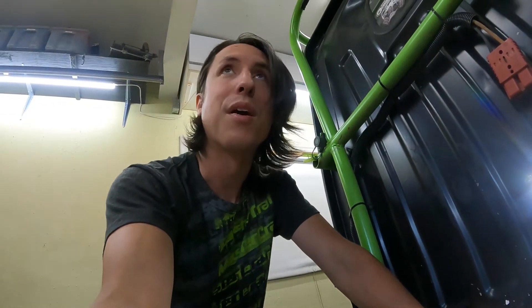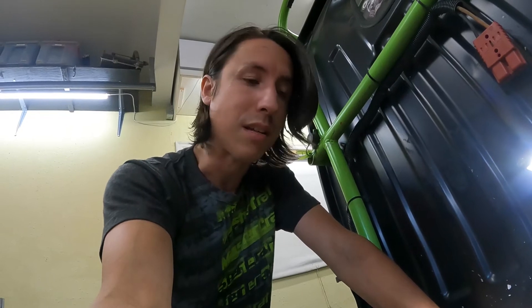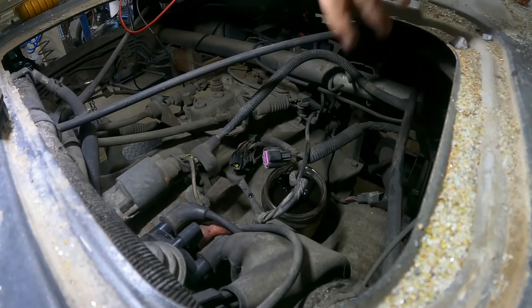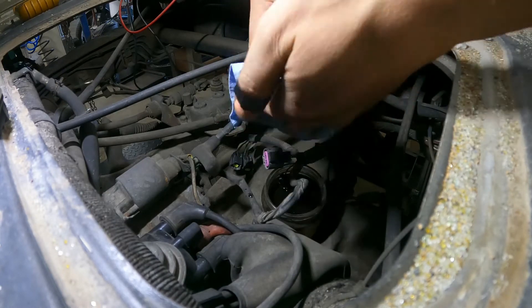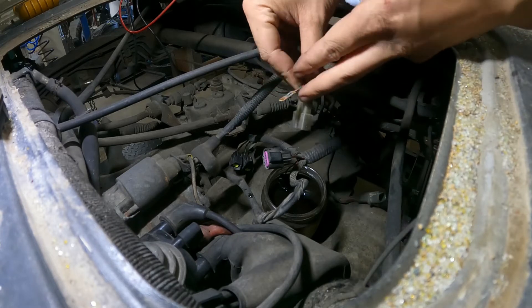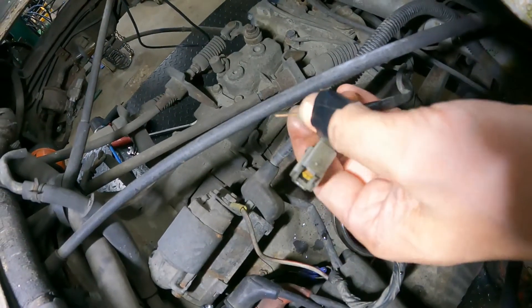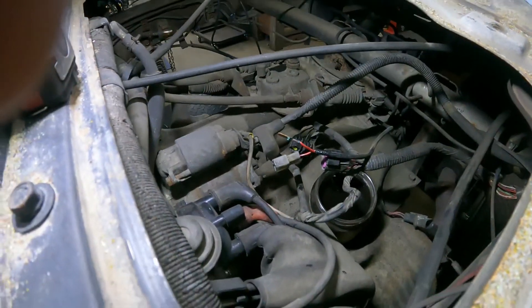I was going to try to de-pin them and sand off all the corrosion — that would have worked for the male side of the plug, but not so much for the female. So I'm trying something different: I found some vinegar I had in my cabinets, filled up a container, and dunked both plugs in there. After about 10 minutes, it's not too bad — a lot of it has come off, there's some shine at the bottom now. It could be a little bit better, but I think it should do for testing. I'll probably end up replacing these plugs anyways.